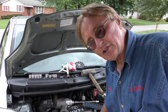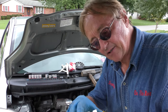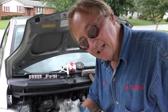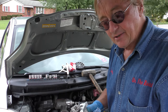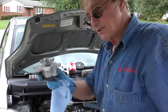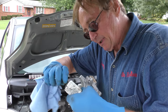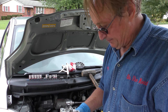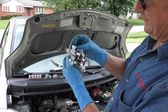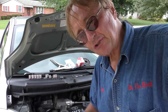You heard it gurgling. Now most cars require you to scrape the old gasket off the engine, but these Toyotas use a metal gasket and the kit comes with a new one — so I don't need to scrape anything off. It's a good idea to get some 3M black weather stripping adhesive, make a little bead so the gasket doesn't slip. Always put the cap on tighter so the glue doesn't dry up. Then look at the gasket and line it up — they gave the right gasket — line all the holes up perfectly and let it dry about half an hour so it doesn't slip.